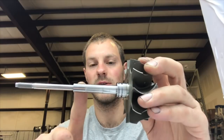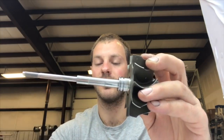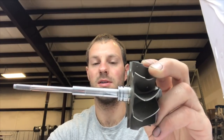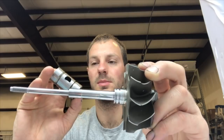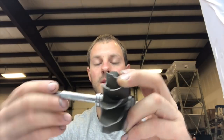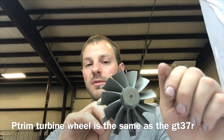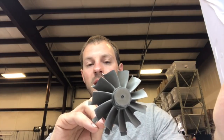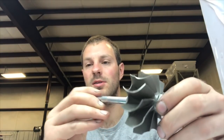The Gen 1 shaft was smaller here than a journal bearing turbine shaft. The back side is staggered for the cage. This is a GT37R — on Precision's Gen 1 they use the GT37R specs for the shaft and the GT37R cage from Garrett. The turbine on this is a P-trim turbine, and Precision had different variations. This is from about 10 years ago.